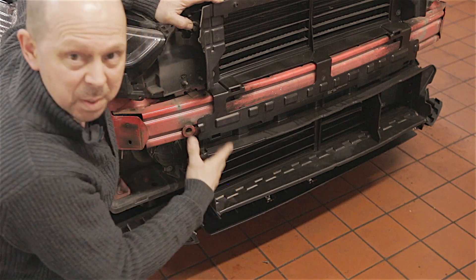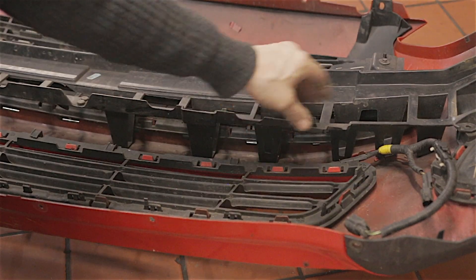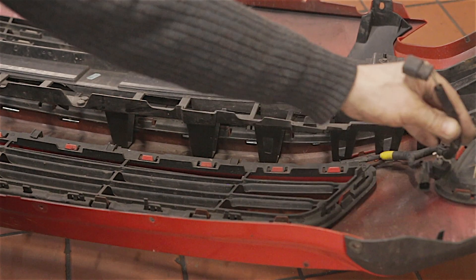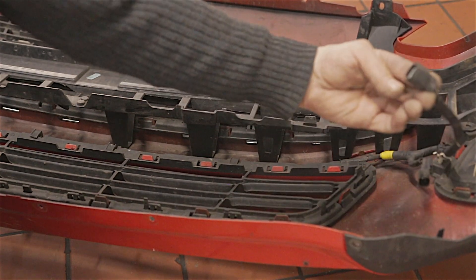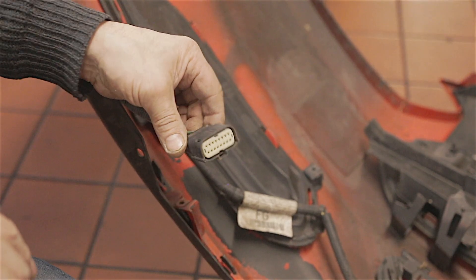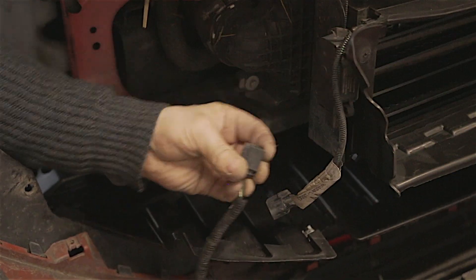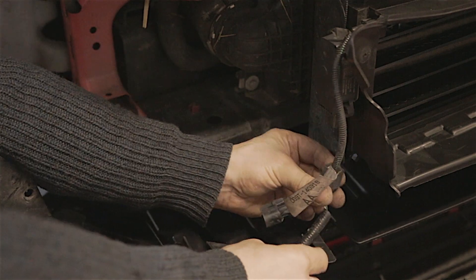What you need to get your head round: the slack goes from the motor to the center. If it's broken, the motor can't tell where it's supposed to stop — the ECU will recognize this and will put the fans on constantly, and your cooling fans will run flat out. The moral of the story: really don't twat your car in the first place. There will be a wiring loom built inside your bumper — two of the connectors go to the motor and your outside temperature sensor. The third connector is the same wires but just connects everything through this multi-plug onto your vehicle.